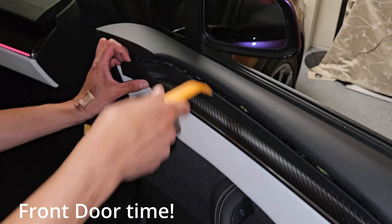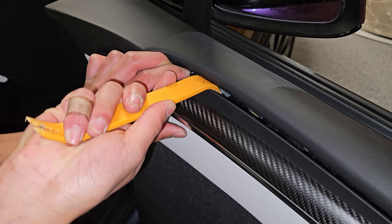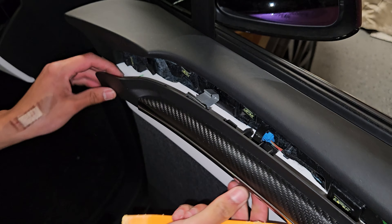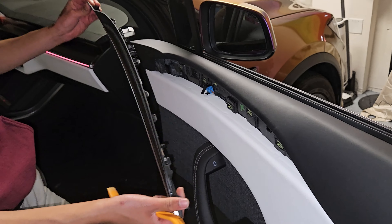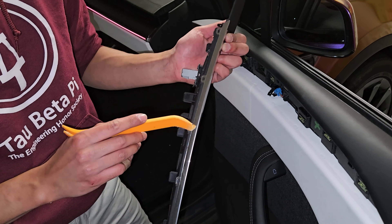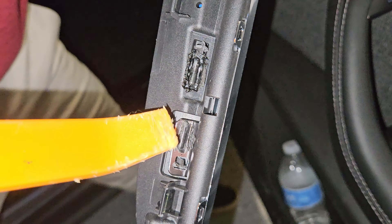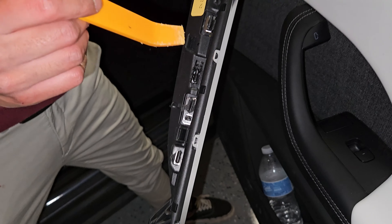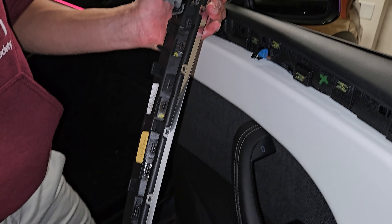Take the bottom kick plate and put it in just like this. Line it up with the tabs — that goes in, then slide it in. Now go ahead and put this weather stripping back in. Use your pry tool and move all these clips. There's a metal clip in here — get underneath it, push down on it super far, and that allows you to pull this out. Pull it towards the inside of the car and the whole thing just pulls out. Then break off the silver part — unclip these plastic tabs and break the bond that's joining the silver to the black plastic piece.